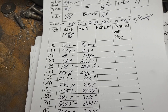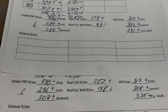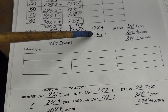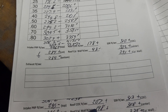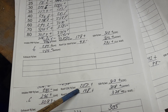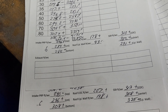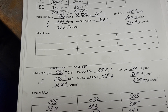That's our 26th cut airspeeds, and these are our 27th cut airspeeds. What happened? Minus, then plus, plus — sped up well over 300 at the bottom of that pinch. This was taken at 0.6 lift. Interesting what happened with the roof speeds — a hundred feet per second difference on this one. And what happened with our short side — plus, plus, plus. The bigger valve really brought it all back quite well — relatively close, not too fast. These are pretty good. I'm pretty sure with a little tweaking on a virgin port that's not all hogged out like this one, I could do something with the 2.1.